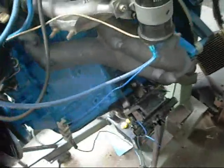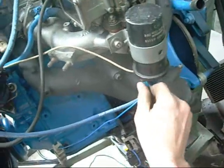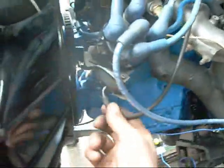Even with the worst cylinder disconnected it's still running like a bag of rubbish, and the spark is a bit erratic in size and intensity. So yeah, I definitely need to work on this ignition. I'll find out what it means when the distributor has to be rotated so far off its normal marks as well — maybe something's messed up inside.